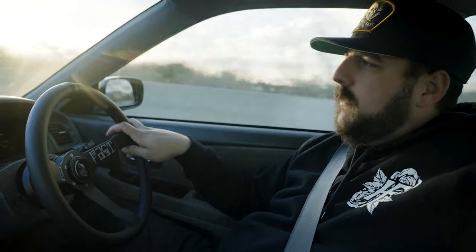Once we start putting power into it and we start drifting it, at that point, we'll start making some fine-tuned adjustments to the angle kit. Everything's balanced really well. Nothing's really shaking. The car just kind of pulls to the left and I can feel tension in the steering. It's not very soft. So I have an idea that it's toed in, it feels like.